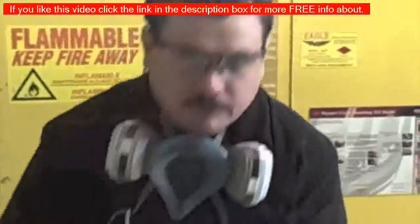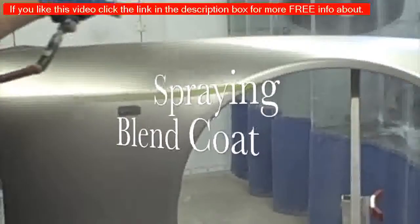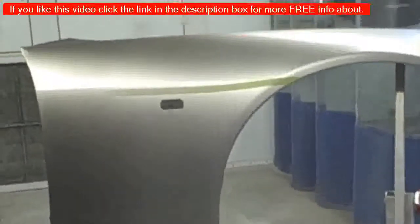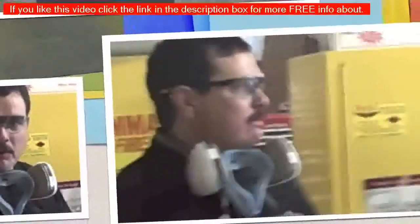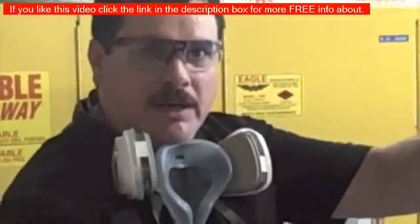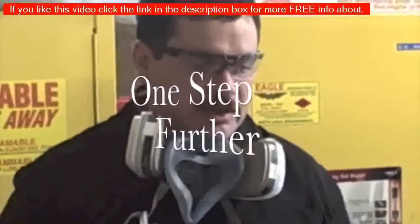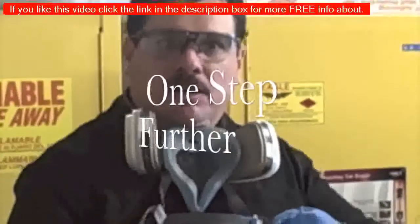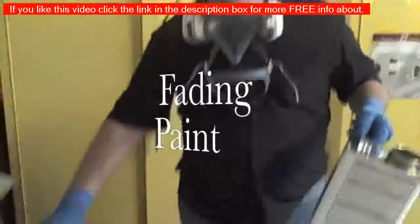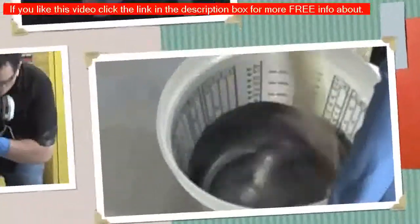Notice that when blending, I painted the original area, went past that a little bit, and fanned it out to let the overspray blend into the existing paint. Normally that would probably be good enough if it was a matchable blend, but this is more like a fade. So we're going to cut it one more time with the clear to make a more transparent blend. I'll mix it the same way — one to one with reducer, then mix what I already have one to one with that. Now the paint is even more transparent.